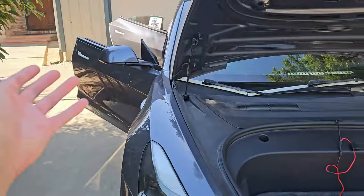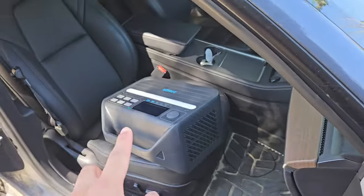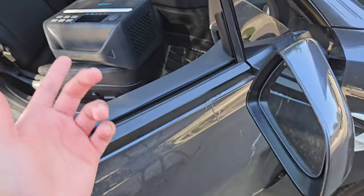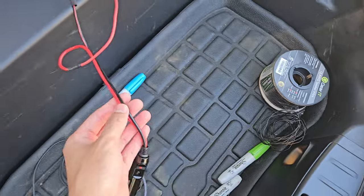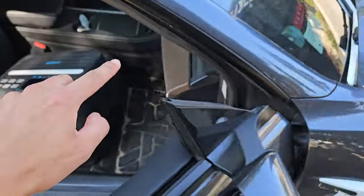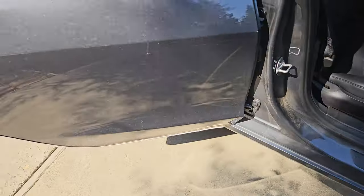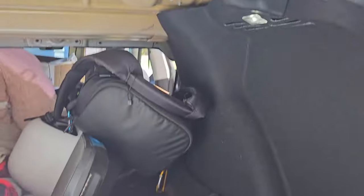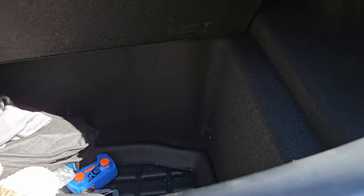Let me explain the plan here. Why are all my doors open? Why is there a wire here? Previously I had this giant battery pack in my frunk — that takes up a lot of space and makes it super heavy. So what I'm going to do instead is cut this wire, route it into the cabin, down through this channel inside the frame, back here, through the trunk lining, and out through here.